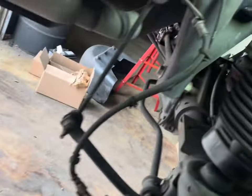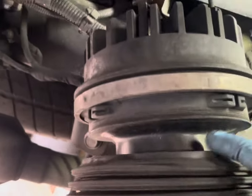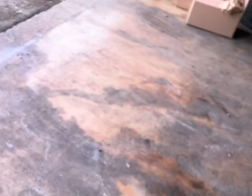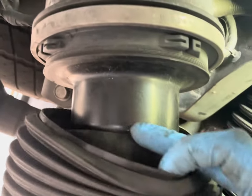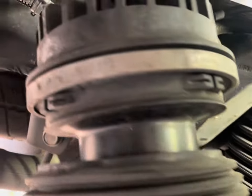I'm going to put in a video here showing where you need to check. You need to take off this zip tie here on the rear airbags, then take off that cover bar right there so this is exposed. You're going to have to get down on the ground — I know that sucks — and spray soapy water right here when you remove this zip tie.